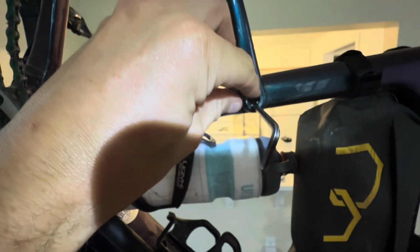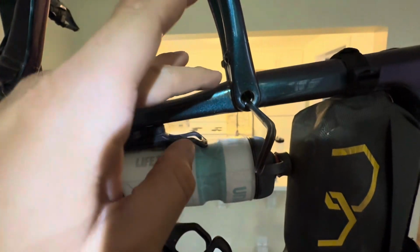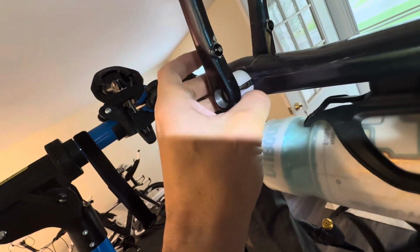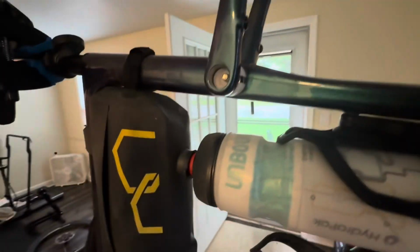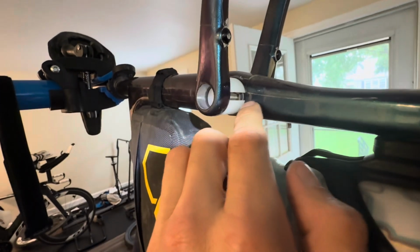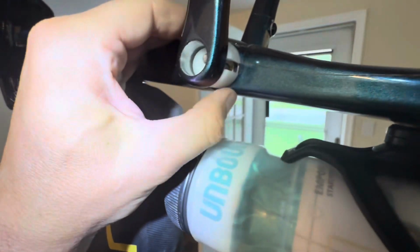There's a little silver piece that is designed to slide basically through the bearing, and then you need to flip it over and then it'll take it out. So the method: you can't slide that thing through this, you have to go in between, and I had it resting in there. And then I used one of these picks to orientate it so that it was sitting upright, and then I put the bolt through it. You can see the bolt through there. That's the purpose of this slit here, so you can then slide that over. And now I am pretty much in position to give this a go to try to get the bearing out. It's hard to align that cup to the bearing. You can see it in there. So I hope that's about right, but we'll find out soon enough.